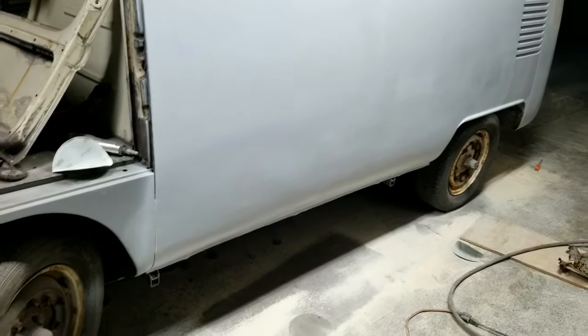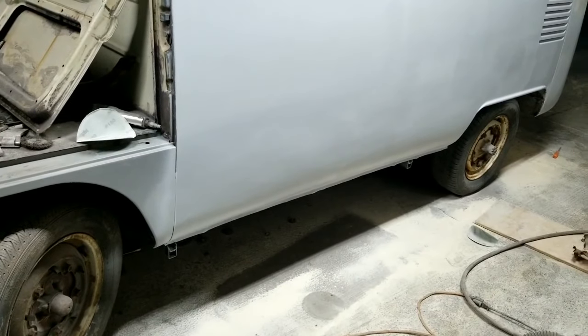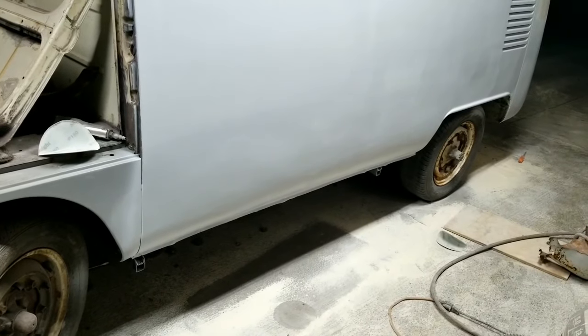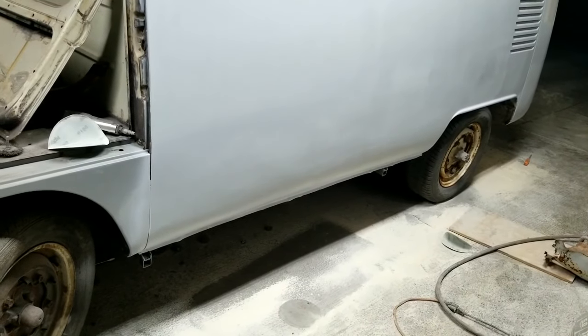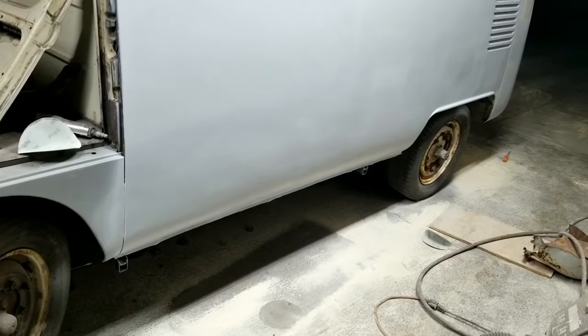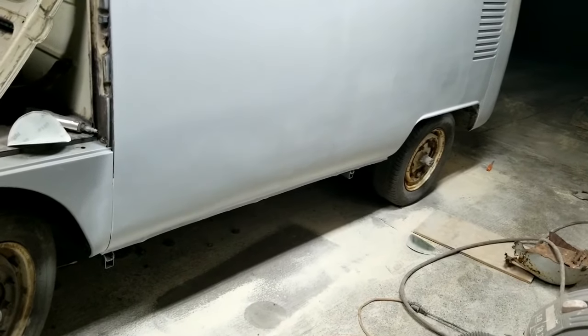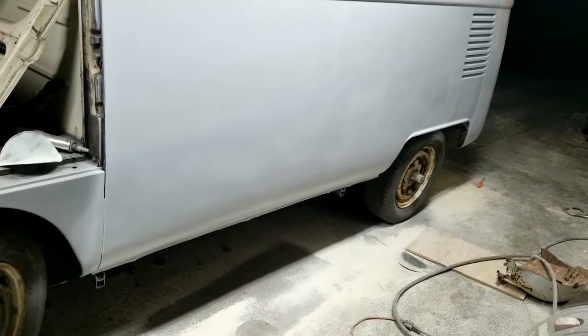Even the old filler, if you did it right, the crappy stuff, guys just didn't do it right. They would put it over paint. And that doesn't work. The newer fillers, some of them you can actually even put over sanded paint, and they'll still work really good. So it just depends on the filler you use. There's all different types now that there wasn't before.